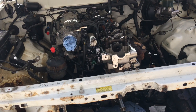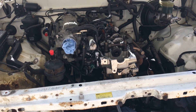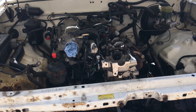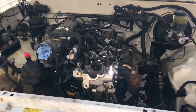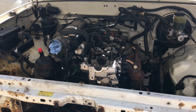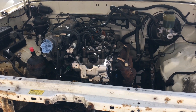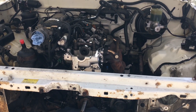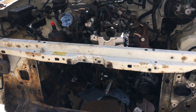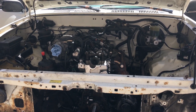What I want to discuss is — I don't know if I want to call it a design flaw, I don't think that would be fair — but it's an issue with the design of the 22RE that it pays to be aware of. If you go to Wikipedia where they discuss the 22RE, they actually make a mention of this, but it's just one line that's very easy to overlook. I'll put the link in the description. It discusses an issue whereby a loose timing chain can puncture a hole in the front timing chain cover, which can introduce water into the oiling system.